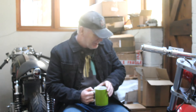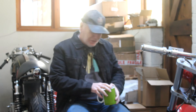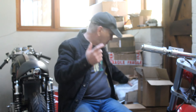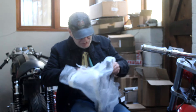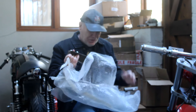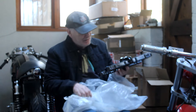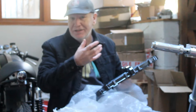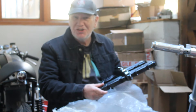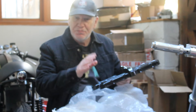In the last few weeks I've been quite busy. The first thing that's happened is that the engine has gone off to Kamco, a local company, to be given a ceramic coating, which is quite expensive. I've just received those engine cases back, and in total it cost me £582, and that's with a complete engine — the crank cases, barrel, cylinder head, and so on. All those parts are wrapped up safely, but here we have one of them — the cam cover — so let's get this open. This is a very hard-wearing finish, though very thin. It does show some of the flaws in the aluminium beneath if you have any corrosion, scratches, or dents. Luckily this particular part is in pretty good condition, so that's not an issue.